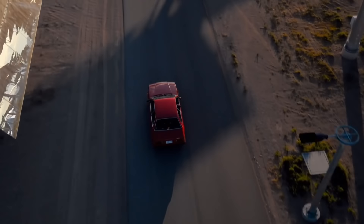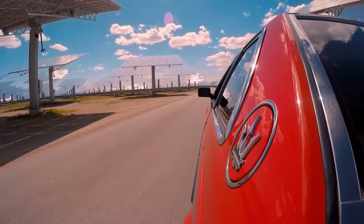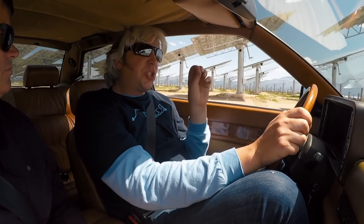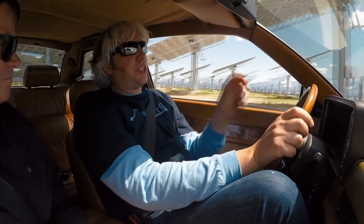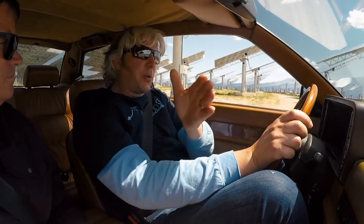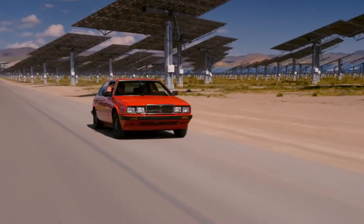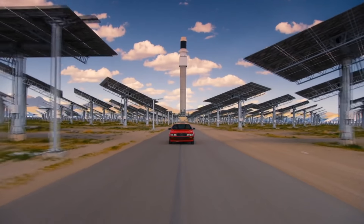36 kilowatt-hours — what does that mean in terms of miles? About 120 miles range. That's not bad. When the Maserati first came out of the factory it managed about 180 horsepower and about 188 foot-pounds of torque. But now this little chap is managing 150 horsepower and 212 foot-pounds of torque. It sounds a bit disappointing — it's down on power. Well, ever so slightly, but with a petrol engine you have to get up into a power band and then change gear. Whereas with this you have maximum power right from the very first RPM. Whoa! Is that for real? Absolutely — do it again! Whoa! And that's in third gear. Oh God, I can feel this car's going to be rapido!